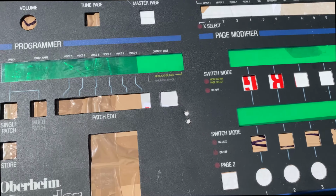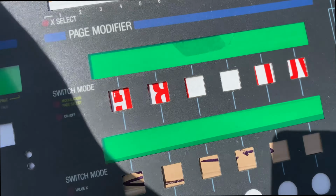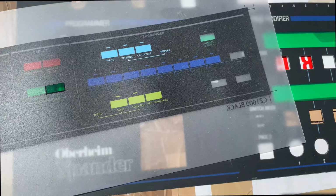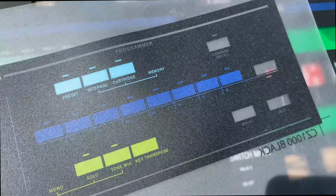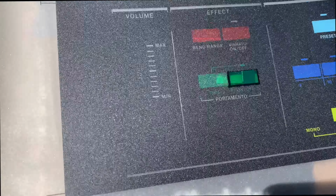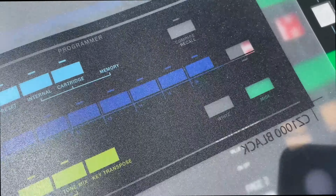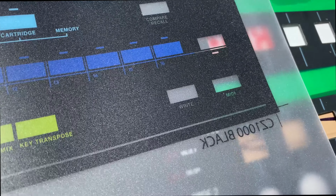You already know that if you're looking at this and you've got one of these sims. What we've managed to do, well, we've used one of our other panels as just a paint surface to work off. And this has also got that metallic colour. This substrate is not the correct one, so when we go on the thicker substrate, it will take a bit more dullness off this because it's coming through further. Okay, we've no idea how many coats of lacquer was on this. I know we can get densitometers and all things like that out, but we're going for original, how it looks, and I think we're going to get there.